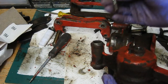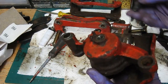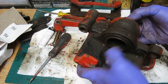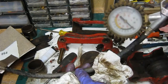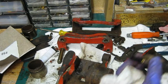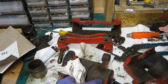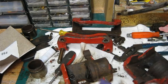What I'm going to do now is start up the compressor. I've got an old tyre valve which I'm going to pop on there, hold it on, pump some air through and hopefully push the piston out. So that worked pretty well actually. I just used the tyre inflating valve with the old tyre valve on the end, pushed that as far as I could into the main hole and just gradually increased the pressure. I had a piece of wood just to stop the piston from flying out and it just generally pushed it out — a lot easier than struggling with pliers.